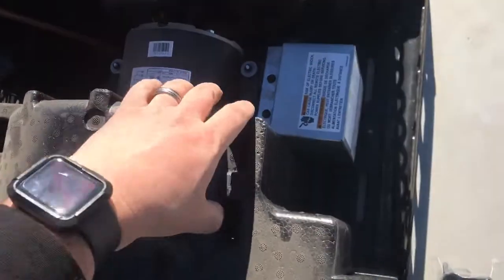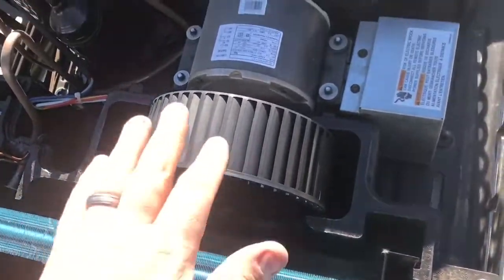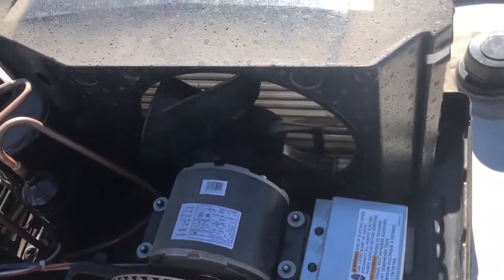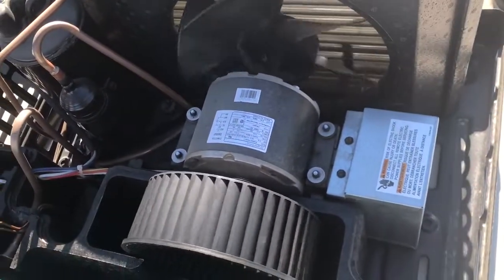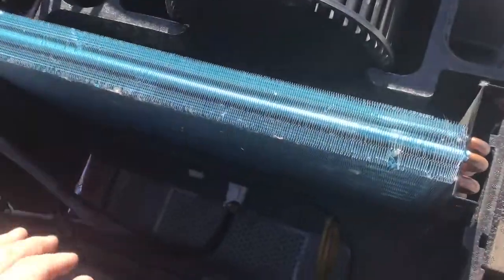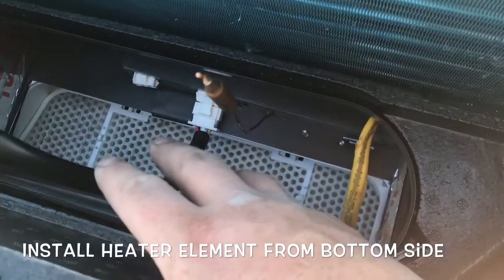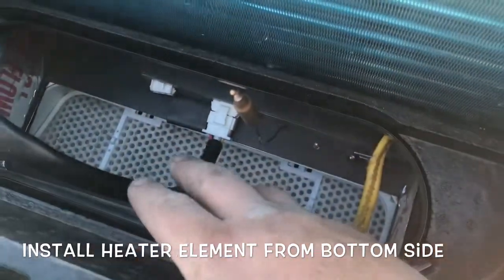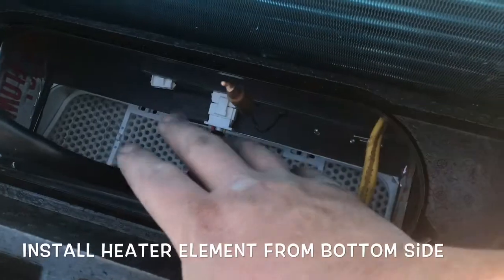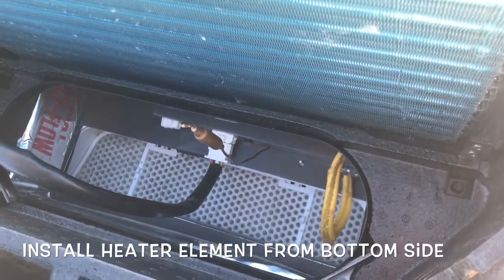This is actually really cool, in case you ever wanted to see the inside of one of these. This is just a foam piece and it separates pretty easily, and then this is the actual blower motor — this is what blows air, and you notice it goes all the way through, so it's just one motor for the fan and for the evaporator. Here's where it actually gets cold on this side, and then down inside here there's a Molex connector, and this is where the optional heat is. It's not designed to really heat up the trailer, but it is designed to help maintain the heat. Those are about 80 bucks and you can get them off Amazon — I'm going to be putting one in pretty soon. The idea is you get everything all heated up and then use that when you're on shore power, so you're not burning as much propane.